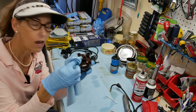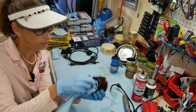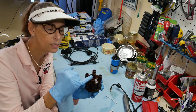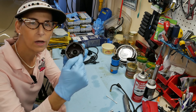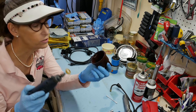I'm going to clean the distributor cap off pretty well. I don't want to use any harsh chemicals on this at all — I'm just using some diluted Super Green. A couple of reasons: we want it to look nice, but this is also a high-voltage area, so if there's any residue that could contain water or any conductive material, it can actually short through here. The conductors inside for each cylinder look really good to me, but I'll just hit them quickly with the brass brush and Dremel to brighten them up a tad.